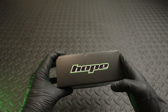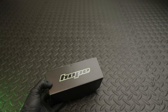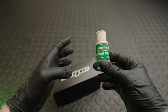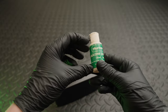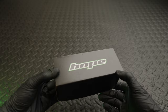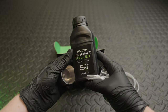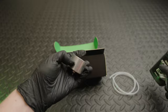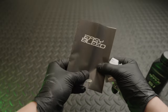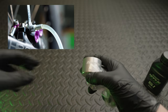Moving on to the bleed kit. This isn't strictly necessary but it does make the job of setting these brakes up much easier. One thing that doesn't come with the kit that I'd recommend getting is some Hunter's silicone lubrication for lubricating the pistons — over time they can become sticky due to brake dust and general dirt. The kit itself is really straightforward: you've got a little plastic tubing, Hope branded DOT 5.1 brake fluid, a small easy bleed cup, and a guide with paperwork. I'll leave a link in the description to Hope's video showing how to bleed these — it's really straightforward.